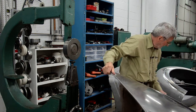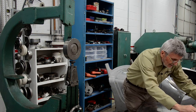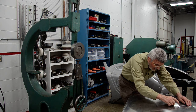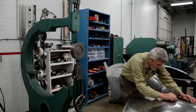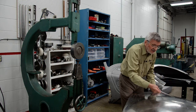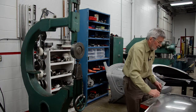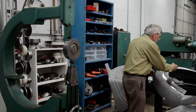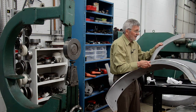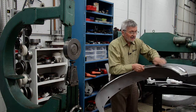I can show you the areas where I was shrinking on both of them. See the gap? That's how much it shrunk. You can keep moving and shrinking more. I already did some shrinking on my work piece, which is a fender — I replaced a rusted section of the fender, and there were high spots. So that's what I did.